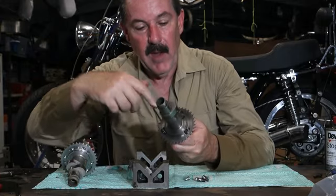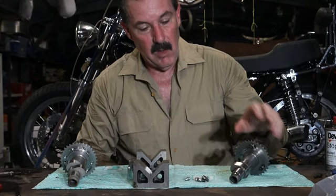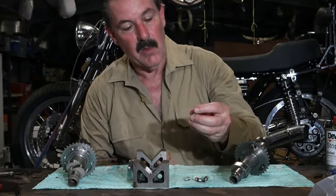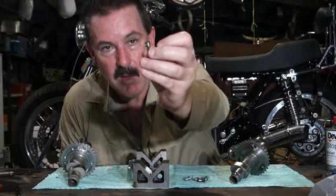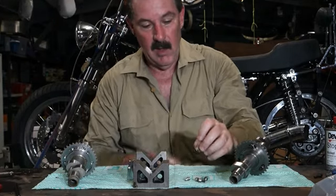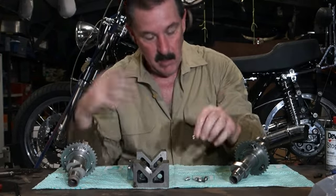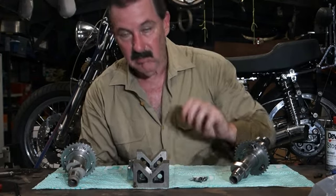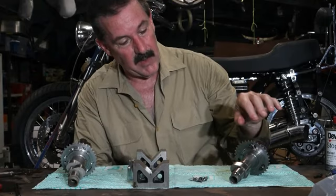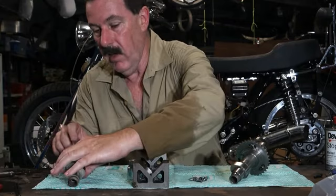I took it out and took the screws out, cleaned them all and everything, because you want to run them with Loctite. And these are also drilled for safety wire. I'm not sure if you can see that, but they're drilled for safety wire. The idea being that as these rotate, if one of them ever backed out, the damage would be horrendous. So I took it out for the last time, cleaned it all, and I was about to put it back